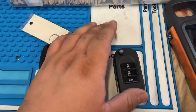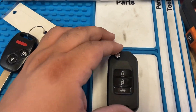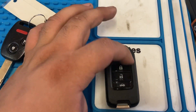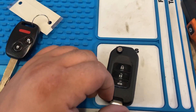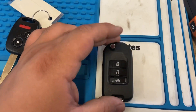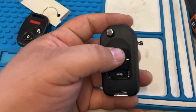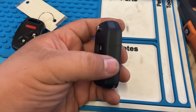The wireless remote is not to be confused with the super remote. The super remote has the super chip soldered on there, which means you're able to do more vehicles than what the NXP can generate. The NXP transponder soldered on the wireless remote — not the super remote — can only do transponders 46 and 47.